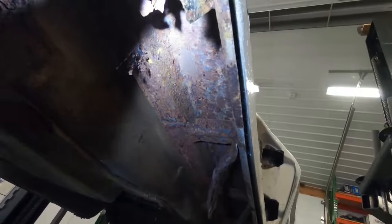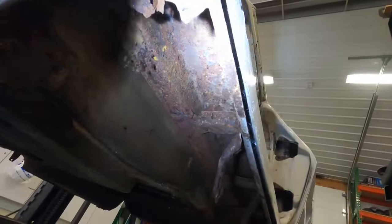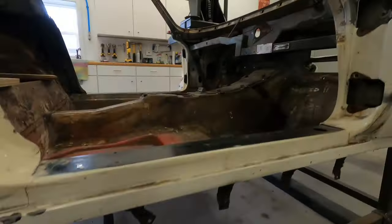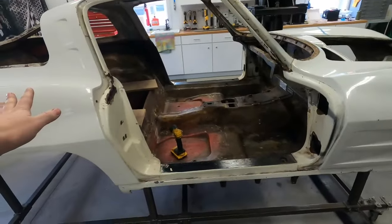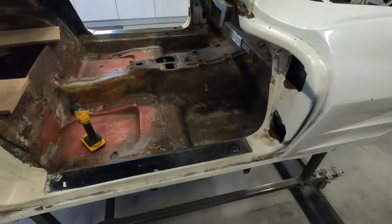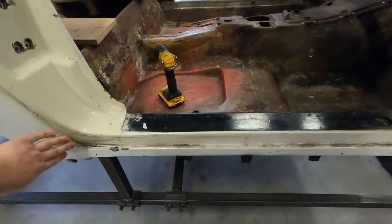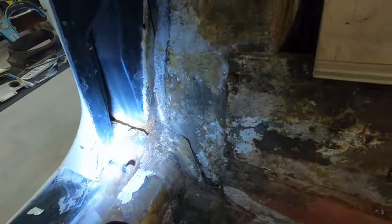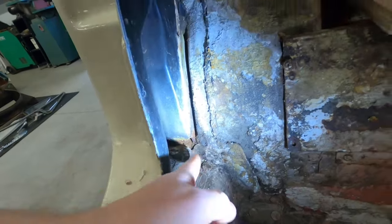Jumping below the car we can take a look at the rocker — it's really rusty. The chassis will later show indications that the rocker is going to be rusty, and it's just in really rough shape. This car is from Ohio so you kind of expect a little bit of rust down below, but this one's pretty excessive. We're definitely going to have to replace the rockers. You might be able to sleeve them in some cases but this one's just too far gone. What I'd recommend is removing the front end, the quarter panel, and all the fiberglass in the door jamb — the B-pillar, the A-pillar, and also the fiberglass rocker. You'll want to put some reinforcements to go between the A-pillar and the B-pillar to tie those two together, and probably do that on both sides to create an H-frame. Because you're going to be cutting off both rockers and you want to keep your birdcage square. Inside you can see a little bit between the floor tub and the fiberglass rocker to get an indication of health, but looking underneath you can tell she's going to need some work.